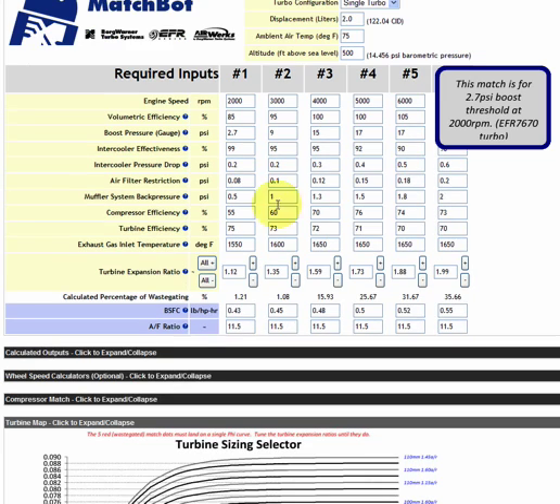In this match, we're going to look at the 2,000 RPM point, and I'm going to put in a little bit at 3,000 and a little bit at 4,000. I'm going to put in a full 15% at point number 1, which is going to raise it from 75% to 90%. I'm going to put in 10 points at 3,000 RPM, raising it from 73 to 83. Then I'm going to put in 5 points at 4,000 RPM, raising it from 72 to 77.